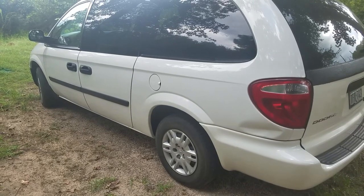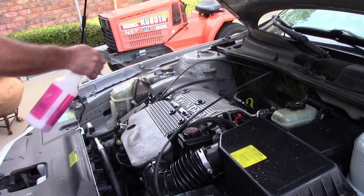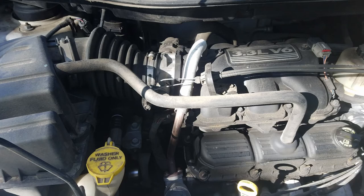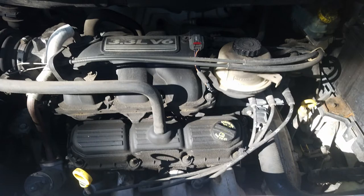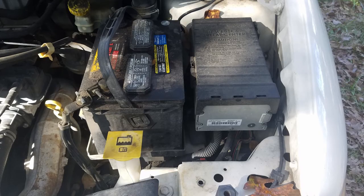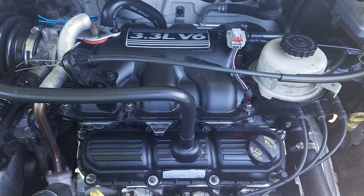Finally, the sixth tip is to wash your engine bay when you are done. For this engine, you can wash the engine bay with a hose, water, and dish soap — scrub all the surfaces and then rinse it down. On this engine there really aren't any spots where water can pool up, but make sure you check with your specific engine to confirm it's safe to wash, because water sitting on the engine can be a problem.